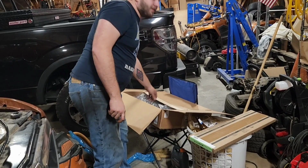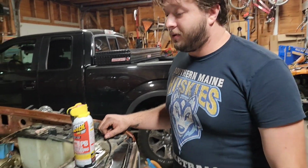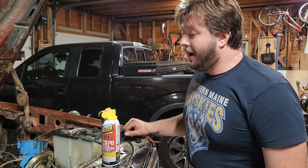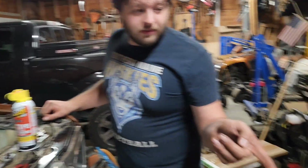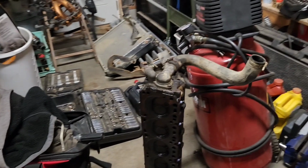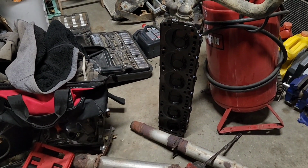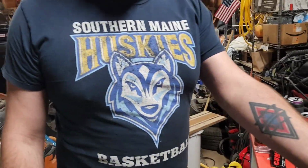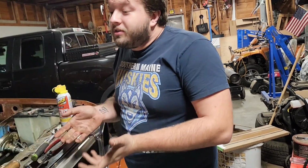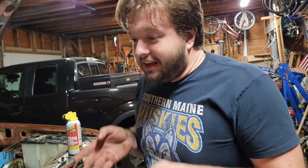Then I'm basically just going to tinker around. I won't really put that on video because it's all typical maintenance stuff at that point, just getting things back in. But yeah, I'm going to clean off the engine, clean off the head. And in case anyone does not know, always stand your heads upright, because when you lay them down, that has the potential to warp. Right. So it won't warp now. Had to remind this dude. I wasn't going to lay it down. The only one that I laid down was the Corolla's.